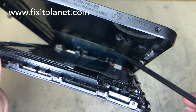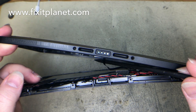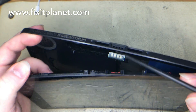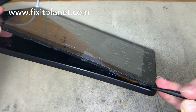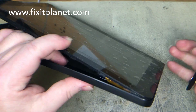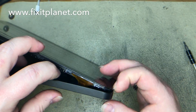There's also a cable connected to the middle of the board here. You can't take the back off until you've disconnected it — it attaches to the keyboard dock and kind of floats in the middle. So disconnect that cable from the main board first. It's got tape holding it down on the back, so it's easier to take it off the main board. We also discovered that screw we missed, so we're going to take that out now.